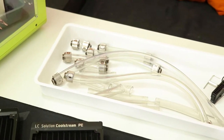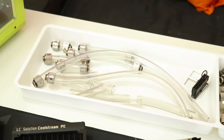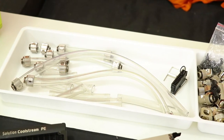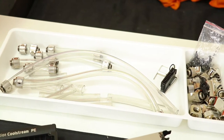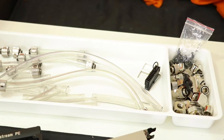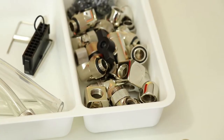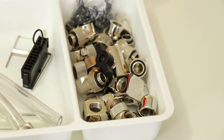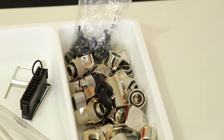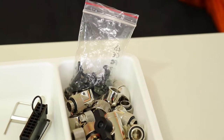As for the tubing, we're using 12x16mm soft tubing and there are already a few runs reclaimed from previous builds. I can generally get away with using identical lengths or cut a previous one to fit — that's one of the huge benefits of soft tubing, but bear in mind it will stain if you use coloured coolants after a matter of weeks. These lengths were reclaimed from clear water builds so they remain nice and clear. For fittings, we have a pile of EK 12x16mm fittings with all sorts of angle adapters, T-splitters, plugs, and even a ball valve for a drain port, which is seriously important.